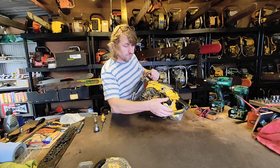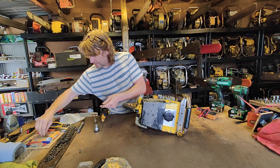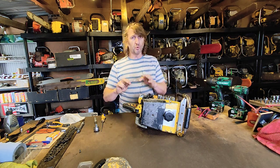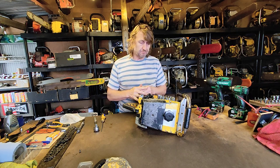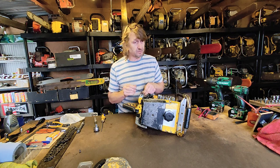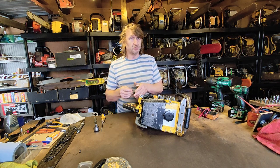Right, so, coil looks in reasonable condition, and part of my test equipment today is just the common things. One wire with a bullet connection, one wire with a spade. You're going to find one of those combinations, unless perhaps on some of the old Stihls, where the wires which come out from the trigger, on some of the 51s, the 76s, actually multiple saws, the 56s, the trigger wire is actually soldered directly into the coil.